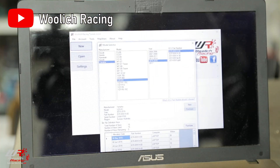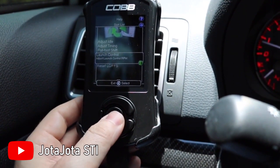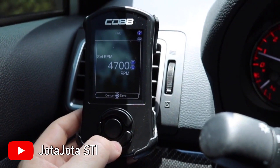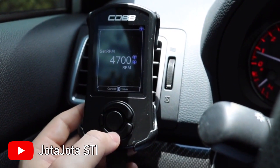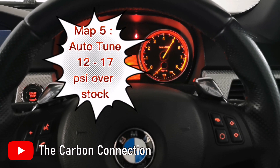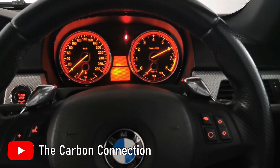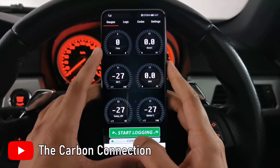However, bench flashing is the only option available for some exotic or European cars. Despite that, this is still the cheapest method when compared with the other two. Some very modern OEM ECUs are very powerful, and aftermarket tuning companies can unlock extra features such as anti-lag, switchable fuel maps, and driver-adjustable launch control, like with Cobb's Access Port and Burger Motorsport's JB4 tool. These features used to only be available on standalone ECUs, but now they're becoming more and more readily available on OEM ECUs, causing piggyback ECUs to become a little more irrelevant.